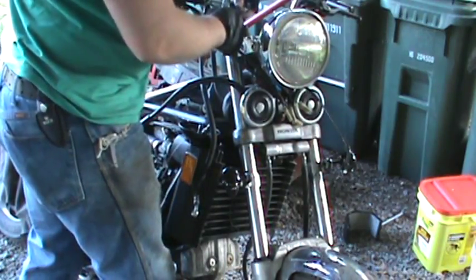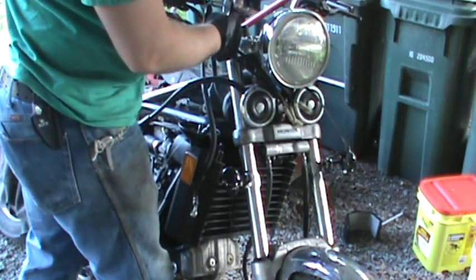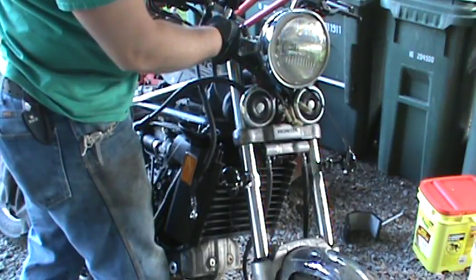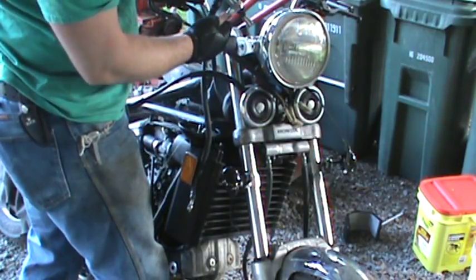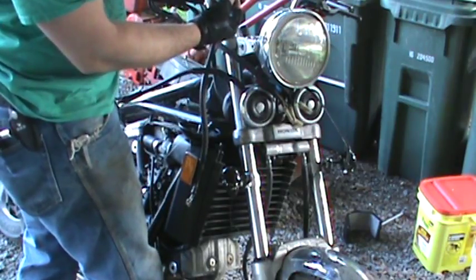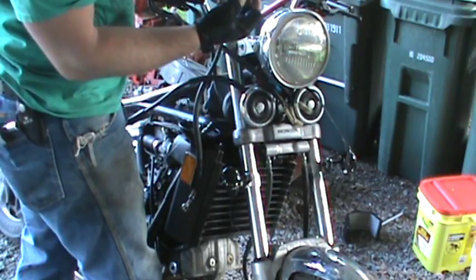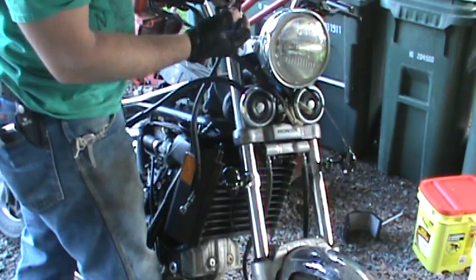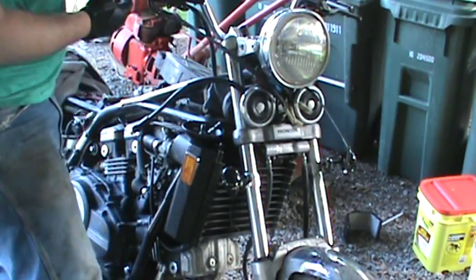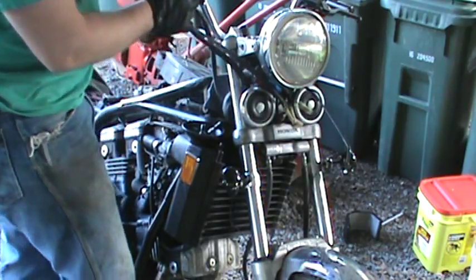Now this one has two washers for gaskets at the top up here. So when you take this off, you've got to be real careful. There's an extra washer on the inside there. Okay, so take that first washer off. Hold on to it. Take off your banjo, and there's another washer in here, right against that. That'll drop out of the way. That one is still good as well, I believe. I've got to double check on that one.